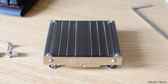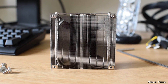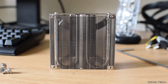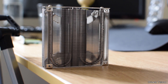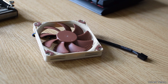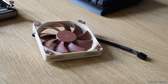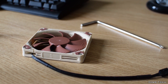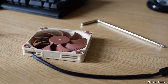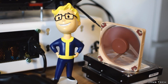The heatsink consists of a very small 24mm short fin stack of many aluminium fins. Although hard to see, there are two copper heatpipes to maximize cooling potential in such a small package. As for the fan, this is a custom variant of one of Noctua's own retail NF-A9 X14 fans, with speeds rated at 2500rpm max or 1800rpm max with the low noise adapter attached. The minimum rated rotation speed is 600rpm, so it should be relatively quiet at idle.